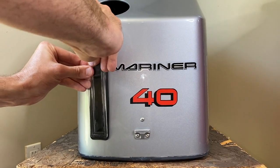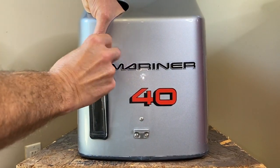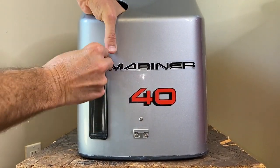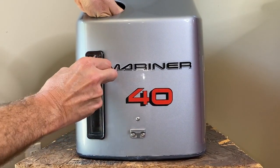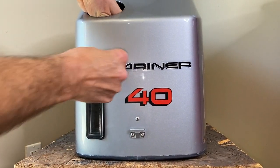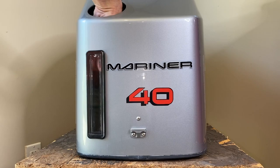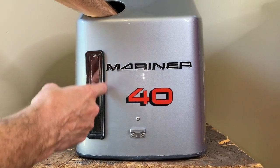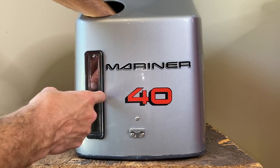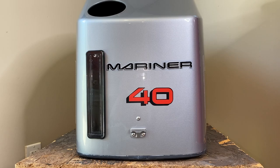as you see, and pressing the acrylic lens in. Coming inside here, pulling up on the rubber seal. From here, I'm just carefully ensuring that the entire seal all the way around is properly seated. And on the back side, ensuring that the seal is still tucked around and grabbing a hold of the cowl itself. In other words, that seam in between the front portion rubber and backside rubber is properly seated. And if that looks good, we'll carefully flip the cowl upside down, go inside, and secure this entire piece with that aluminum plate and lock washer.